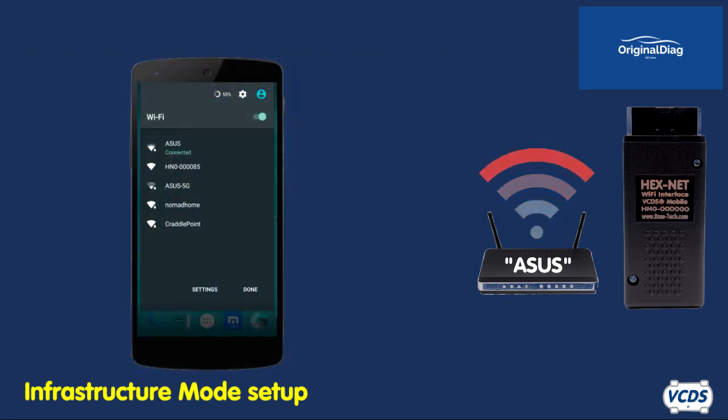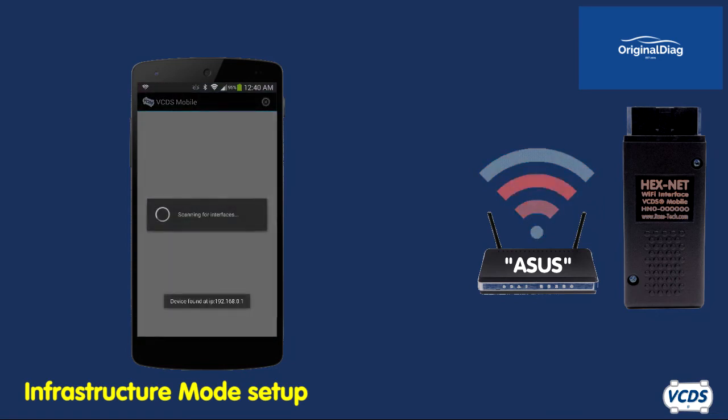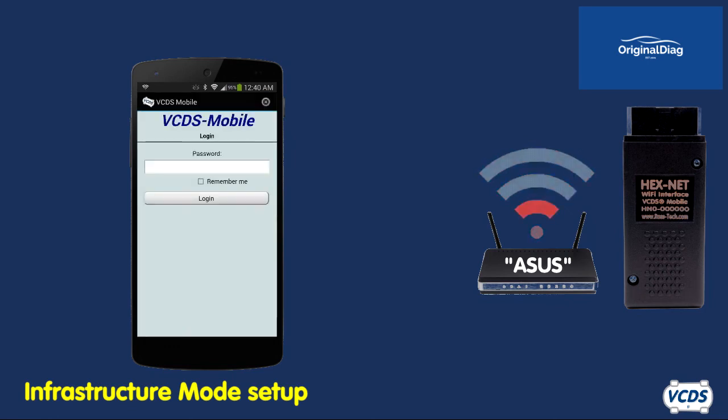If using a smartphone or tablet, connect to the same wireless network the HEXnet is connected to. Then start the VCDS mobile app. The app will identify the HEXnet and show you the IP address. You are now connected to VCDS Mobile.